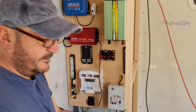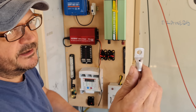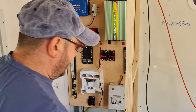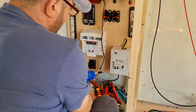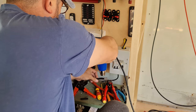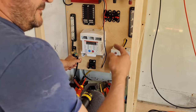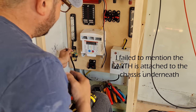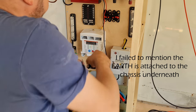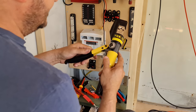So these are mainly the terminals I'm using: that's for 50mm square cable, 35mm square cable, and I've got some 25mm. This negative is just going through the floor. Some people will take it all the way back to the battery, but it's five meters of cable whereas I've used about a meter here, and it's a perfectly good earth.